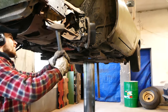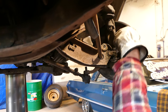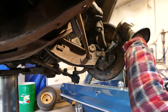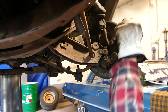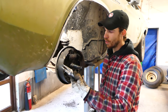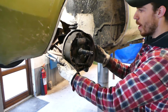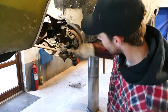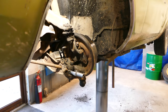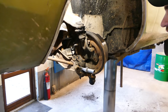It's still not loose - yep, at the stock as well. Still not loose. The problem is the pickle fork has to go in this way, but then it hits the spindle. If we put it in this way, it's too steep of an angle, and there's not room on the other side because the steering arm is there. So I wasn't able to get the pickle fork on. This is my first time actually changing ball joints in a Mopar. It just hit me suddenly that you can remove the backing plate with the two big bolts right there - suddenly you have all the access in the world to knock that thing right out. You live and learn. First try - that was pretty easy!